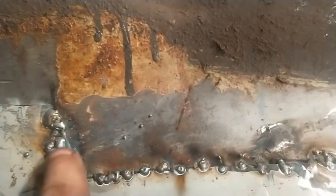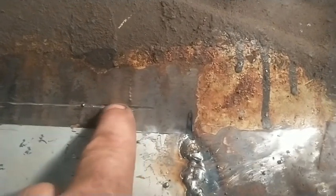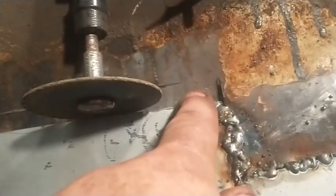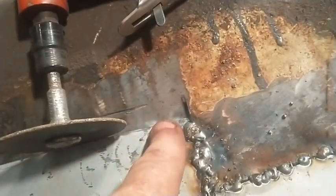Next step on this is to grind it down flush again, see where I've still got spots, weld those in. And here — I cut a little too high or I hit it with a grinder — I'll weld that up. But this new floor still overlaps the old floor right here. So what I'll do when I'm ready is I'll run the die grinder in at an angle as much as possible so that it keeps the gap cut between the two sheets as skinny as possible. If you can get them to touch, that's what you go for — this piece and the old floor touching — that's the best scenario.